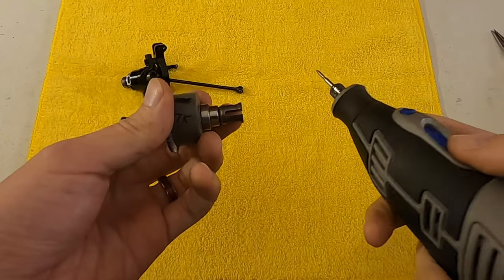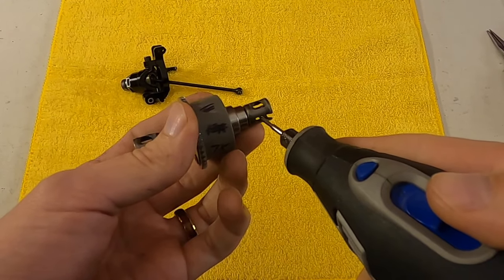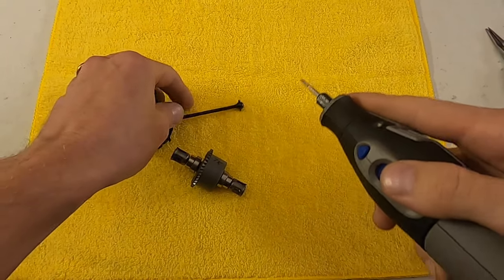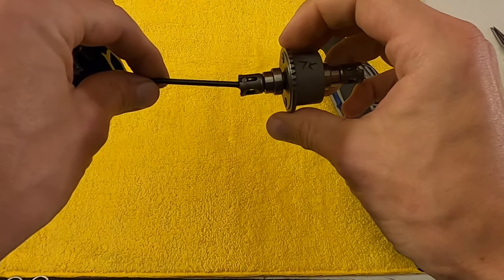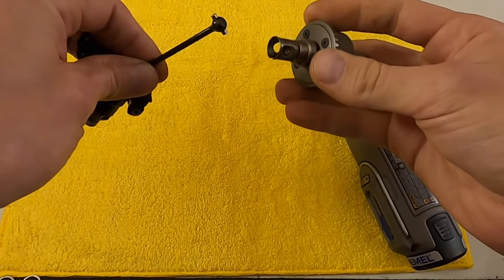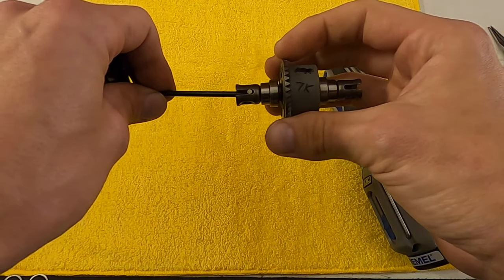A lot of that reason is your driveline. When these things are brand new, when your out drives are brand new, this area is super smooth and these pins are super smooth — it doesn't create a binding characteristic as they're working through the motion. It's very smooth, and so you don't have what I call support, so when you're on the throttle these things can still slide a lot easier.